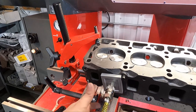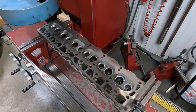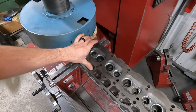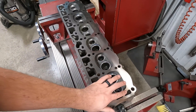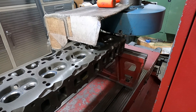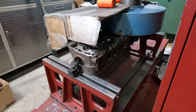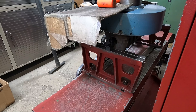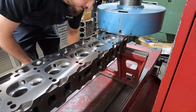It's kind of what I anticipated — we've got a little bit of funny business. This one's all cleaned up on the corner here, it's cleaned up over here with the exception of a spot there on that cylinder, this is all cleaned up and it cleans out over here but nothing over here, so we're going to keep cutting. In general, the goal is to take as little material off as possible just to get it flat again. We're making multiple passes, usually around two-thousandths of an inch at a time, and then I'll do a half-thou finish cut which gives it a nicer surface finish.